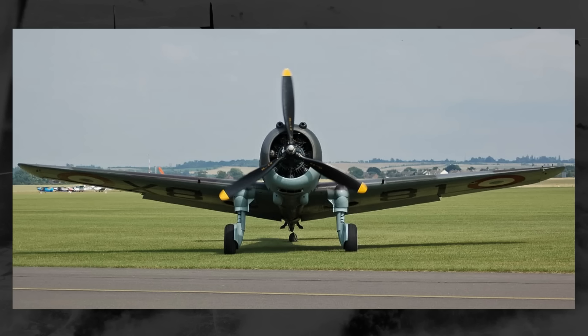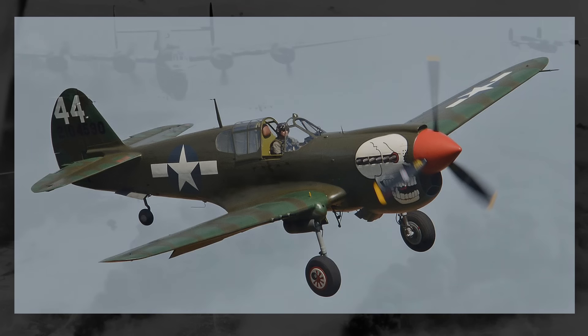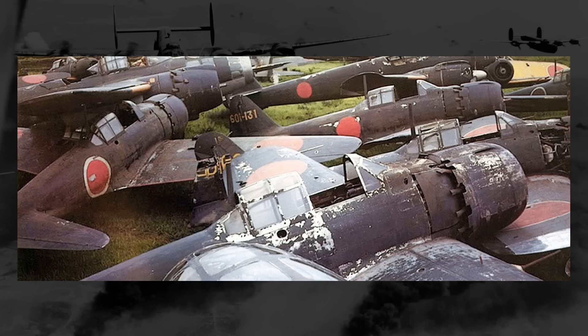This is one of the bigger advantages of inline liquid-cooled engines — the nose can be more aerodynamic and closed. So why are we talking about radial engines? In World War II, Japan was quite attached to them. They didn't really have the manufacturing capabilities or the resources to produce inline engines en masse, and they generally preferred the reliability that radials offered. Plus, with radials not needing cooling systems and thus being lighter, this fit quite perfectly with a lot of their smaller, lighter fighter designs, which in turn often gave them fantastic maneuverability.